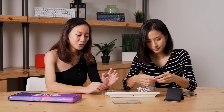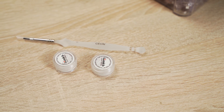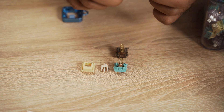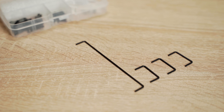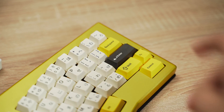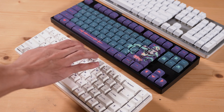Right now we're just assembling it. Usually before assembling, we have to mod each individual switch. When I say modding, we are actually referring to lubing each component. That sounds like a lot of work for each individual! Yeah, for a 100% keyboard I really spend about a good 2–3 hours. I didn't mention these stabilizers at first — you can also mod them. You can only hear the difference when you put the keycaps on, then you can hear how an unmodded stabilizer sounds versus a modded one. As long as you use the keyboard regularly, I don't think you ever have to re-lube it, unless you're planning to use it for 10 years down the road.